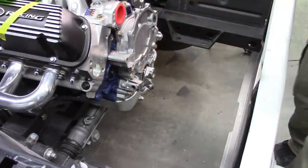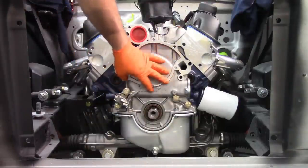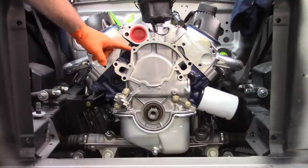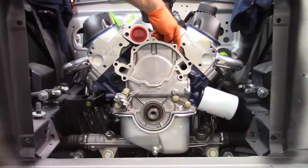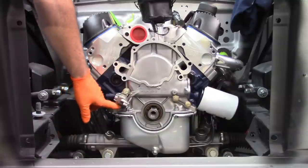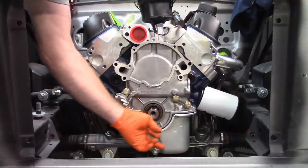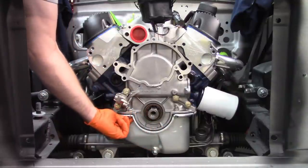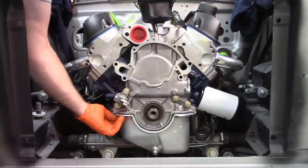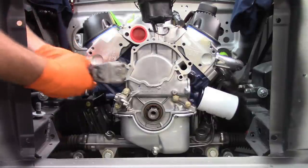So, that's off. Okay, now I'm going to try to get the housing off. I'll point out there's two bolts behind this flange where the water pump mounts, 9/16 at these locations. The front one near the front of the crank going up is 1/2 inch, and the one further back is 3/8 inch. I think they wanted to see if they could use all their different bolt sizes in one setup. So I'm going with these 9/16 first.